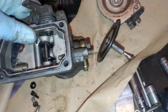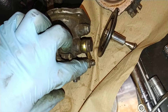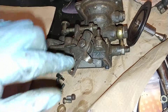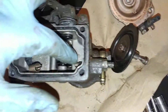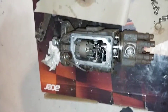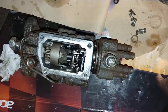They say to watch out for your truck running away because even at zero throttle this sets your weights at a point where it can run away — that'd be bad because then your governor spring can't stop it from hitting its rev limiter. But this mechanical cable here will shut the fuel off. If you're adjusting this mechanism, sure, have a board with your buddy to cover the intake, but also this will shut your fuel off if it starts to run away. The reason that screw does increase your maximum fuel is because it physically rubs on this mechanism over here — I'll cover that again in the next video about the actual pump body.